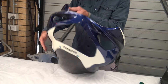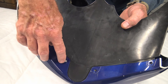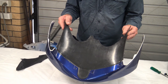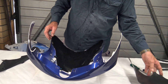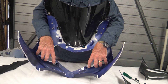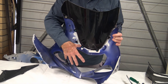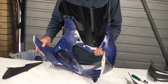Now we talk about the headlight cowling. It has another component of the air dam which sits underneath, and there will be four panel pins that hold it in place, plus two panel pins up here that connect to this section. You could leave it in place in theory as it will pull forward, but there's a good reason to take it off. Apart from the air dam for the radiator, you have two air intakes for the air box, and it's always good to be able to get at everything to give it that extra bit of pressure to pull it apart. This also comes apart with the headlight and instruments in place, and there are two cables that run to the right-hand side that need to be disconnected, making disconnection a lot easier.